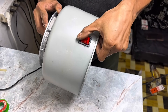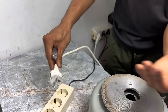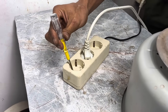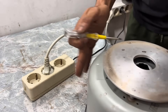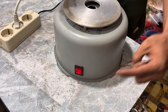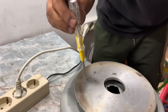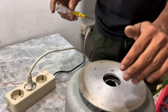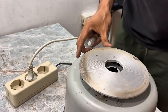After all the processes are complete, it's time for the proof part. First, let's check for any electrical leaks — I'll use a test pen to ensure the parts of the electric stove we're building are safe to touch. This is crucial so we can use this device without fear of short circuits or electric shocks. Make sure everything is completely safe before turning it on. After carefully checking each part with a test pen, I was finally able to confirm there was no current leakage.